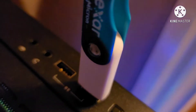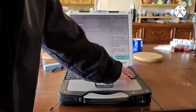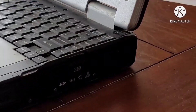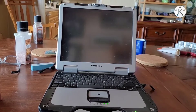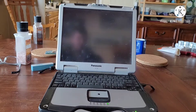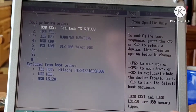This time the USB light is a bit more consistent. Copying is done — let's get to Bertha. Entering the BIOS is as easy as pressing Function 2. I'll change the boot parameters to exclude the hard drive from the boot process and prioritize USB booting. Let's open up the USB side panel and insert the USB — first and only, by the way. We hit the Panasonic POST screen, but I realized I hadn't saved my settings. I'll go ahead and prioritize the JetFlash USB and this time remember to save.